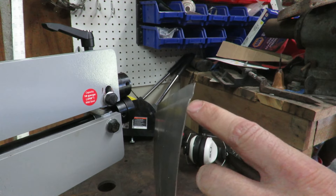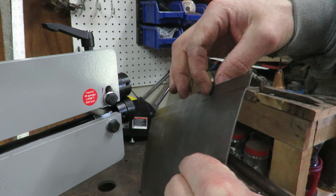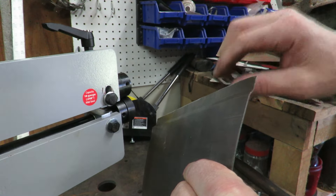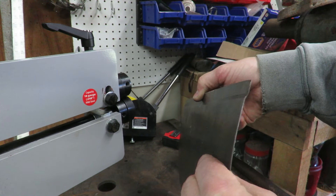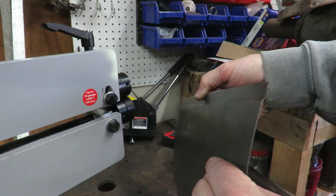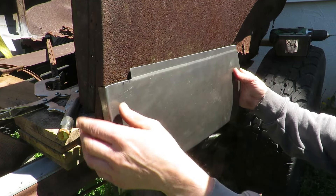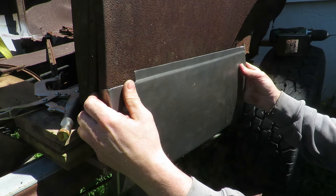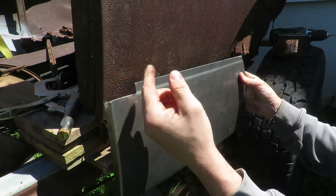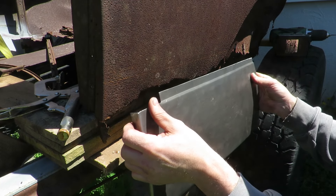As you guys can see now, I've put in a little bit of an offset. So I'll lay the actual sheet metal on the car on this side, and then this will tuck up on the back side, and hopefully we'll get a fairly good seam right there. This is the first one I'm trying to do like this, so we'll see what happens. The plan here is that this is going to butt up right like that, and then this is going to tuck up on the back side. The reason why I notched this out is for the B pillar — the B pillar is supposed to sit up against this sheet, so I didn't want to get it in the way.